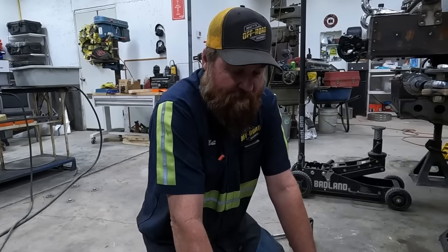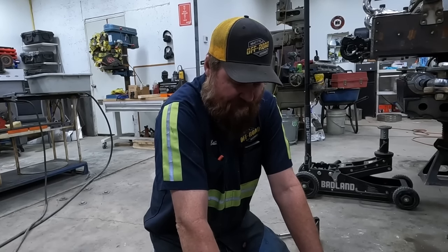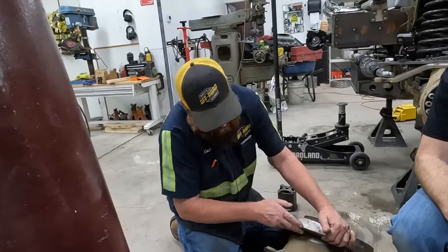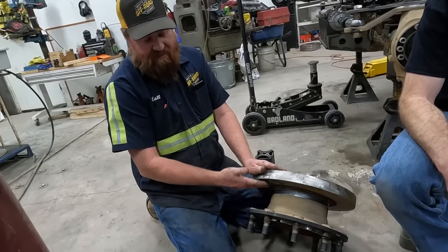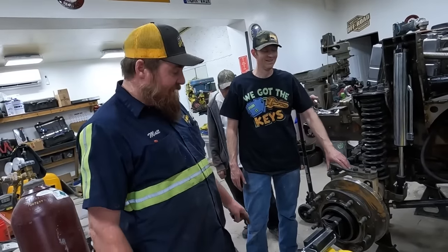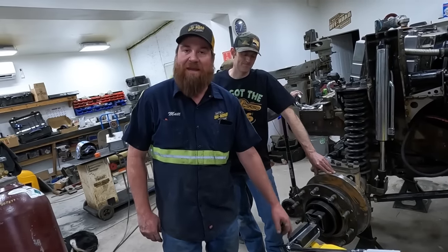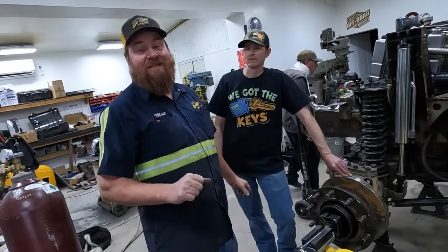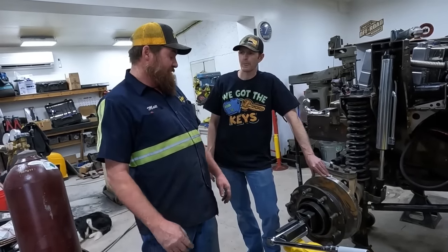This is the first rotor going on. We've already converted it for juice brakes — converting from air brakes to hydraulic. That meant going from 17-inch down to 16-inch so we could use the Kodiak calipers. The Kodiak calipers are super wide, so a spacer had to go in there because there wasn't enough room between the hub flange. There's a rumor that if I have 222 foot-pounds of torque here using this extension, I'll have frictional losses — but it doesn't matter because we're transmitting kinetic energy through there, not releasing it. So we are getting 222 foot-pounds regardless of how long the extension is.